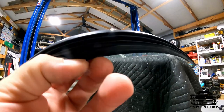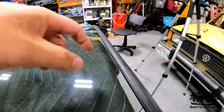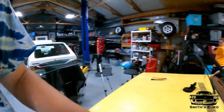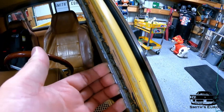Down here on this bottom edge there are like three little rubber sections, and they have a bottom edge that we're going to run wire or string through. You loop it down here and up here, then you silicone all of it up real good and push it in. Someone holds it tight outside while someone inside grabs the loop and pulls it, so the inside of that flap comes over and locks onto the little metal pieces. Then the metal keeps it from pulling back out. Speaker wire works really well for that — that's usually what I use.